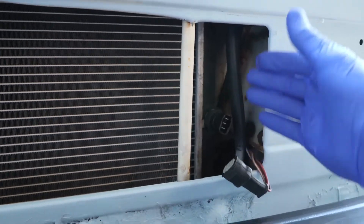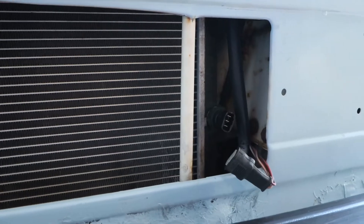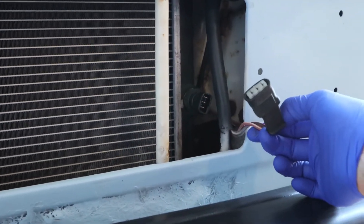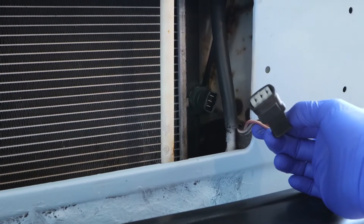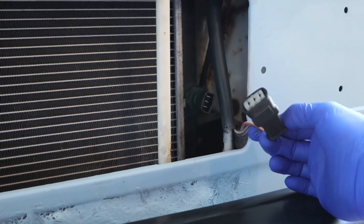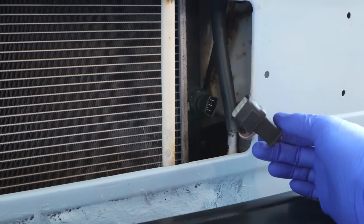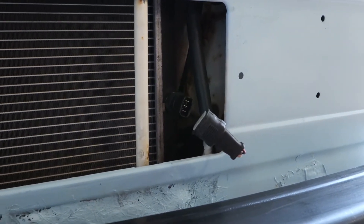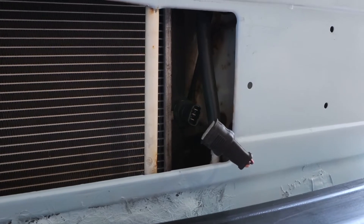It's kind of like you're starting from the beginning and working your way back. There's other options — there's a switch, there's two fuses, and there's another wire that branches off of this that has a fuse or some type of receiver or something. I was also told if you have a high idling fan, check your air conditioner. Even if you have your air conditioner removed, if the switches are on, it can activate the fan. And sometimes those have been quick fixes. I already tried that — that wasn't the case.